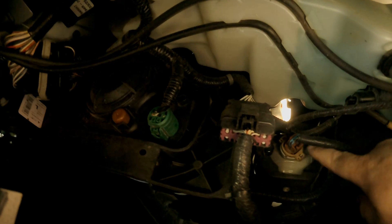So I've got the dust cover — whatever this is — little thing back. I want to show you this too, if you can see it. There is the fog light, and this dust cover right in there is where the headlight is. We're going to take that out right now. You just twist counterclockwise to undo the dust cover, and you're good to go.